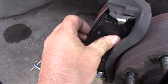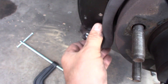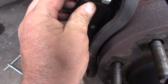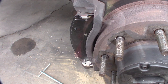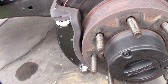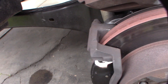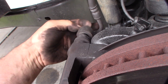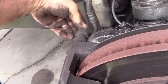This part right here acts like a spring — kind of under spring tension. You could probably lube those a little bit. Now I'm going to flip the caliper back on. Pretty basic — just go in there and get the screws in. That's it. Get this aligned. One of the easiest things to do on a car, actually. It takes usually just a few minutes. This truck is pretty heavy so it takes a bit longer — I have big tires — but on a small car you can get it done.